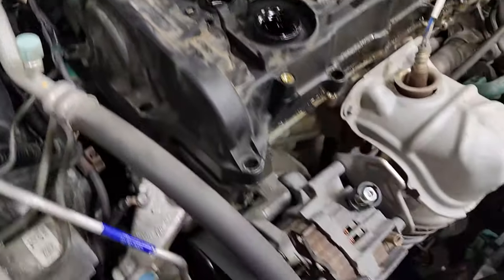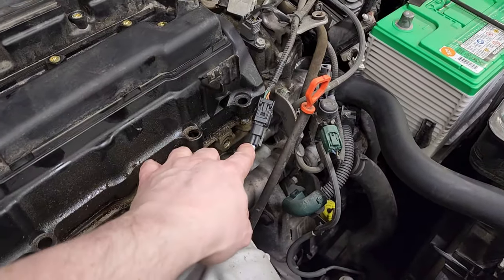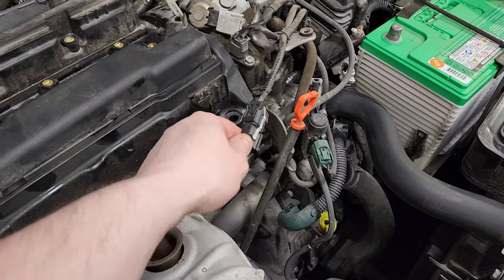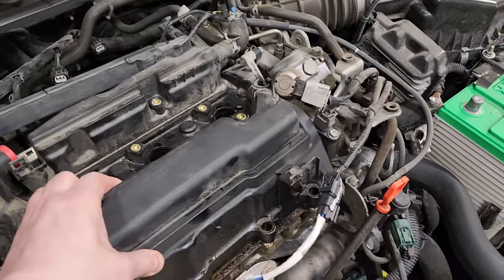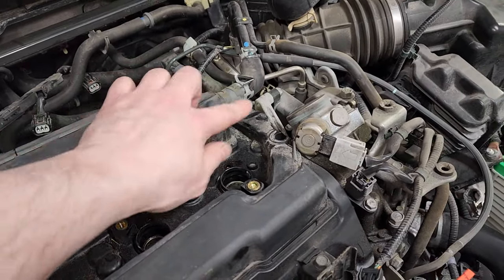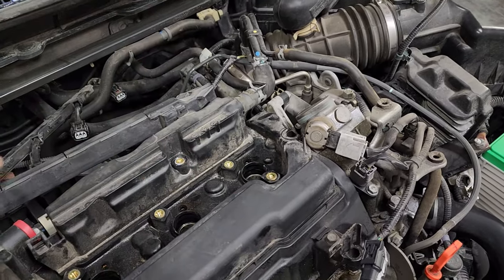It's actually pretty annoying. Then you've got this here — this goes to one of your upper O2 sensors, just kind of slides right down there, you just got to slide that off. The only thing we're left with now — this is essentially loose — is when I lift this up. I've already kind of loosened around there, so when I lift this up I'll actually be able to pull that off a little bit easier.